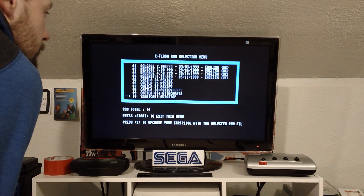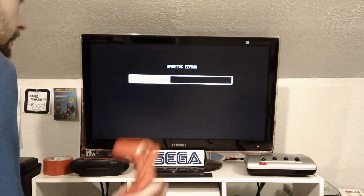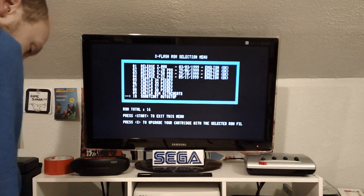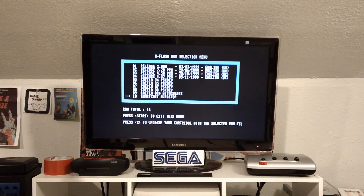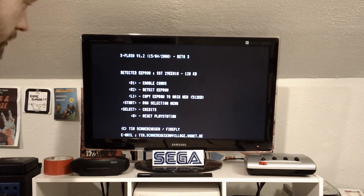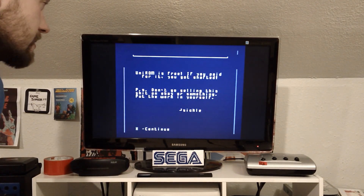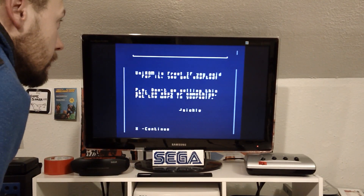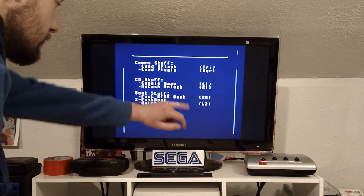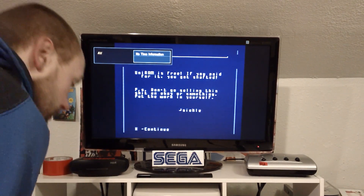I press Start and can't get it to do much with the standalone, so we'll go with the plug-in. Press X to upgrade — this is what you will see. It won't flash anything that is too big, because it will read how much memory it can flash; if it's too big, it simply won't do it. Exit this menu, reset PlayStation, press Circle. This is what you get when it does work. Fast boot is what I always use if I want to boot something — homebrew or whatnot. That is how you flash your parallel PlayStation cheat devices.